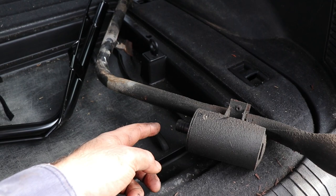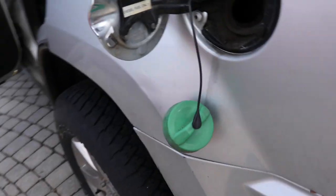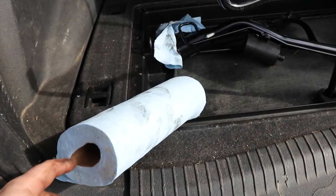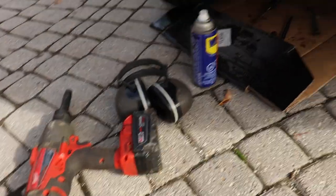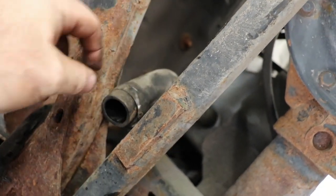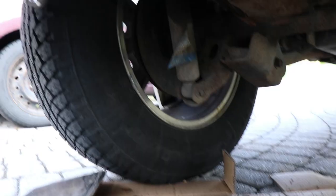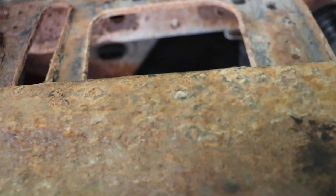This line here I just yanked on from down here and it popped off, and then I just pulled it through — it went through no problem. I am going to stuff some towels into the filler neck before I put in the new one. I had the impact gun out but never used it. I used WD-40 and a 13 millimeter, and really took my time getting that bolt out because I didn't want to break off anything. There's a basic clamp there, so I used a flat screwdriver for it. As soon as you get that off, stick a cloth in there as well because junk will be falling down — there's lots of garbage up in here.